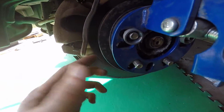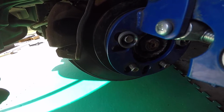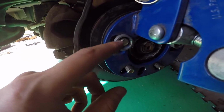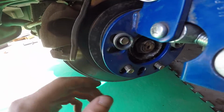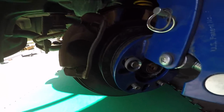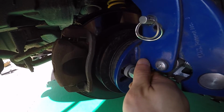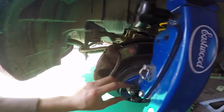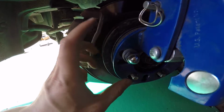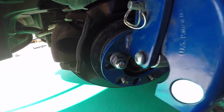I mean, the fender roller's made out of pretty solid steel, so I don't really see why it would be damaging it, and you don't have to actually reef these on. You just want it tight enough so that the fender roller isn't moving. So usually what I do is I'll have one of these spacers and a lug nut just on either side. So once you have these snugged up, just so that the fender roller doesn't move, then you can move on to actually rolling your fenders.